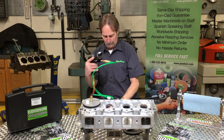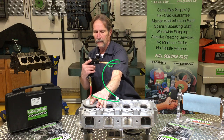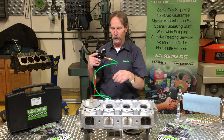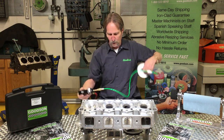I'll show it one more time. You can see how that pulled down here — I've got my 24 inches of vacuum, I've got a good seal in this combustion chamber. Get that vacuum release, take that right off, and away we go.